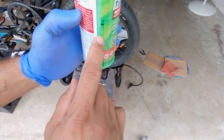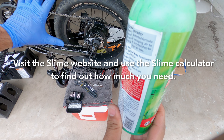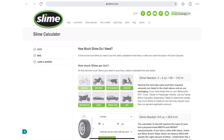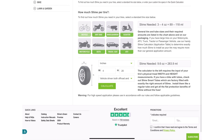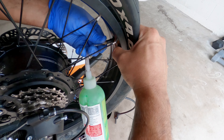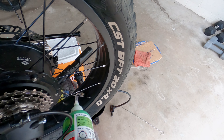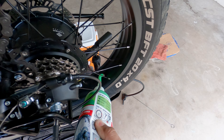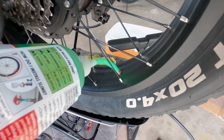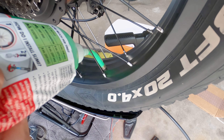The bottle's marked — I have eight ounces left, and that's exactly how much I'm putting in on this bike. Make sure you check for your bike what the amount is. On this e-bike, on my electric XP, I need eight ounces. Basically I'm just going to put this in here, connect the tube, and then squeeze it all in. Since I know I only had eight ounces left, that's exactly the amount that I need, so I'll go ahead and put that in.